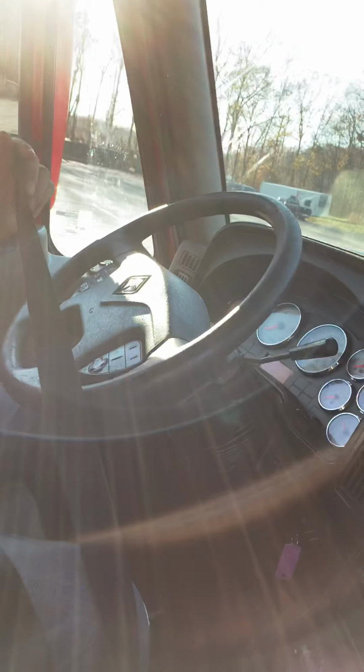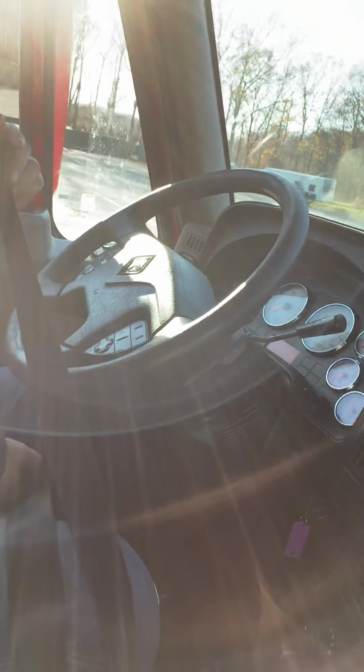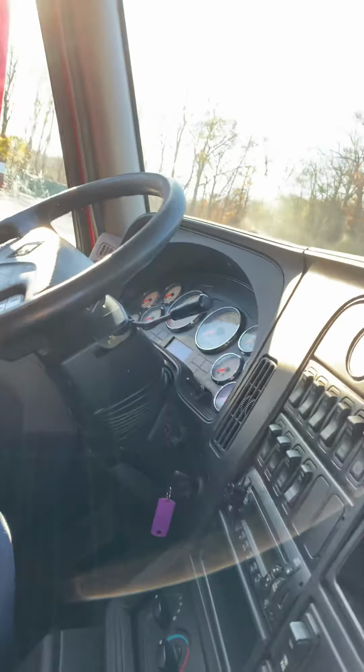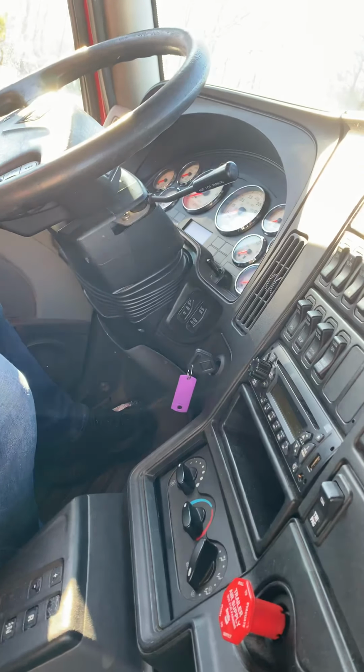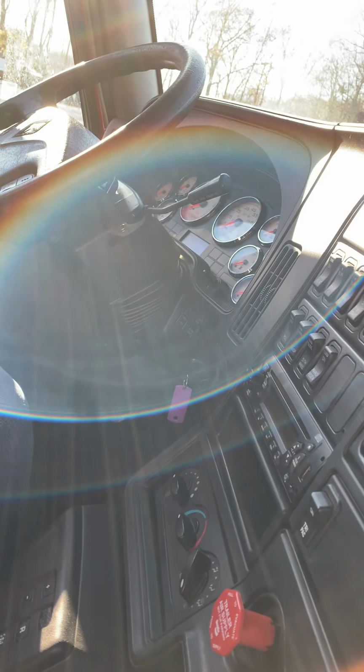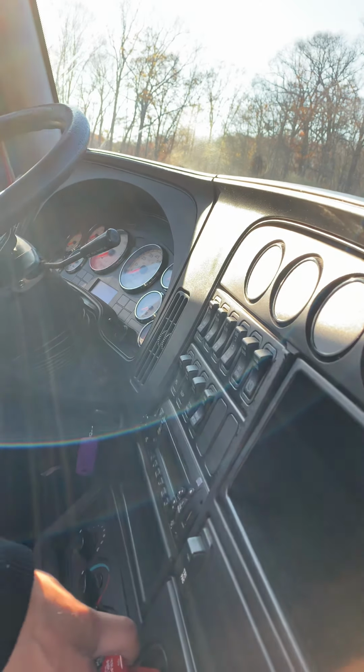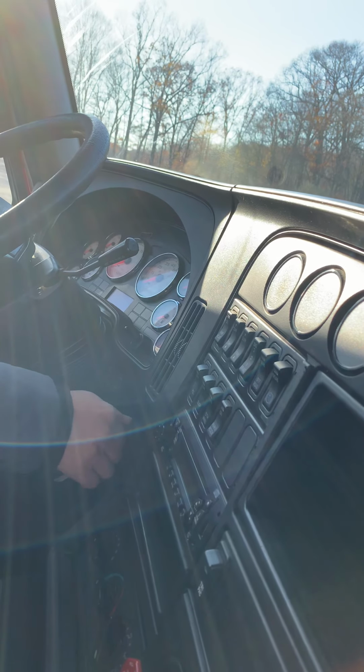Before the safe start, clutch all the way down, and put the gear shift in neutral, and be sure the parking brake and the trailer brake are popped out. So be sure the truck is not moving. Be sure right now the clutch is all the way down, then turn to the ARM position.